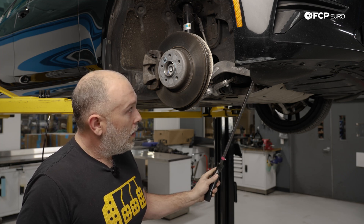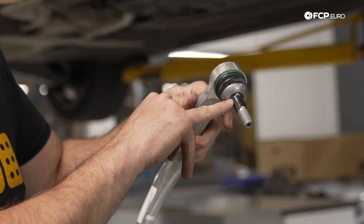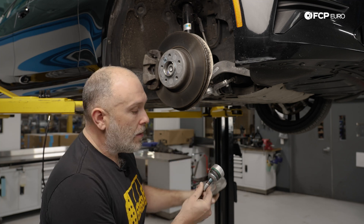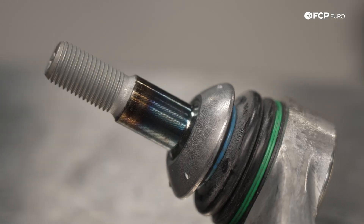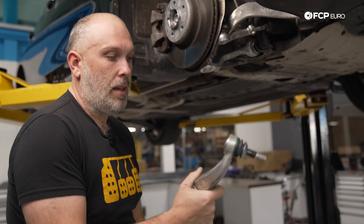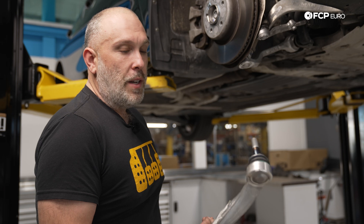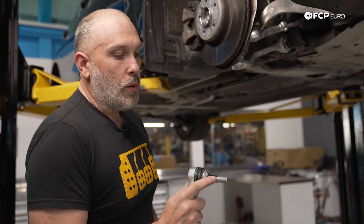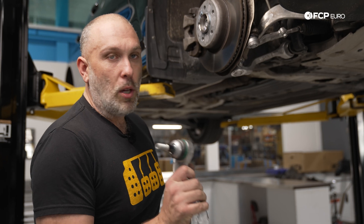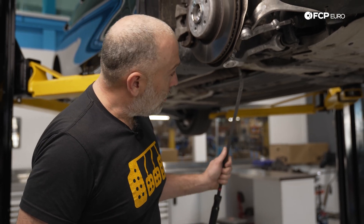This bushing inboard is the one that's known to fail more often than not. Back in the day, BMW used tapered ball joints — a stud with a taper that would insert into the knuckle and a nut would clamp it. They've moved away from that design and now use a conical or almost round seat which helps locate it without a straight taper. Theoretically these should not get seized in the knuckle, though that has been known to happen. In a perfect world you remove the nut and can just pop these right out with no special tools. This style is the same for both the tie rod, thrust arm, and wishbone.